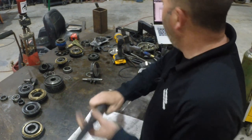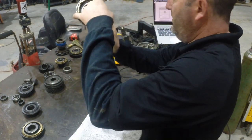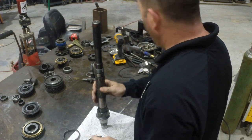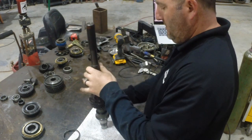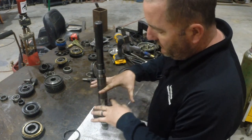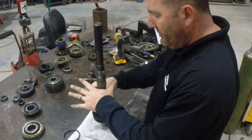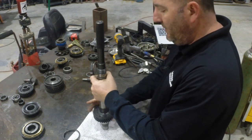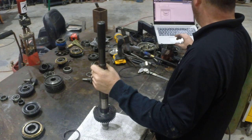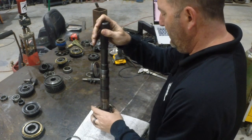First step is our second gear needle bearing. This guy right here is second gear, so the needle bearing goes on and we're going to install second gear. As we put pieces together — especially when we start to press things and put lock rings on — I want to spin everybody who's involved. If you push something on and then the gear that you just put on stops spinning, something's not right. You've installed something incorrectly or maybe something's not aligned.